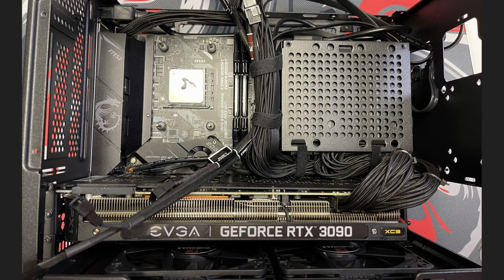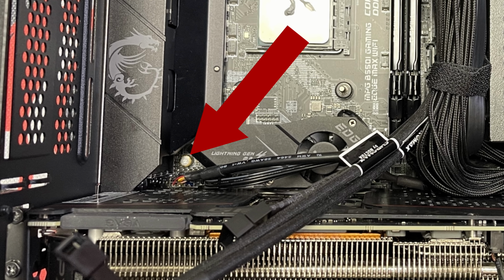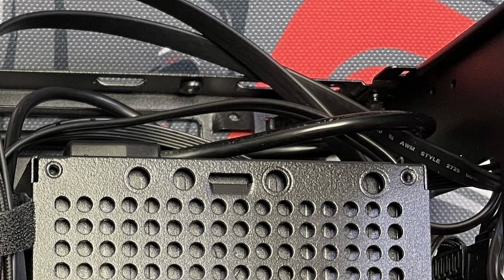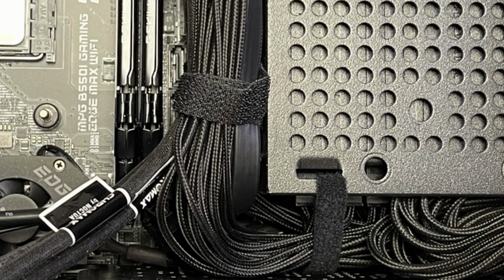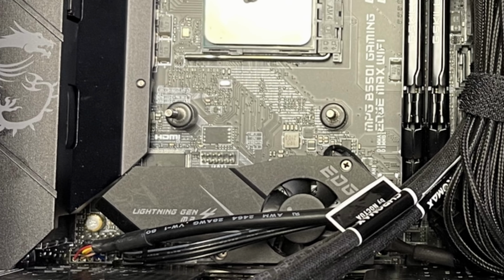If you take away the actual problem I had with the CPU and the bent pin, the only issues around installation were that of the GPU. The two things here: down the bottom left of the motherboard are the front controls for the audio and the power, and then, of course, you have all the cables coming out of the PSU and what to do with them. So in the end, I routed the front controls down past the RAM and over the top of the GPU. There really weren't a lot of choices on that, as well as the front USB is kind of buried down there behind the nest of cables.